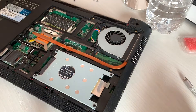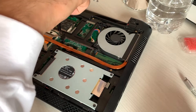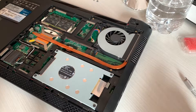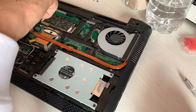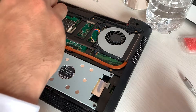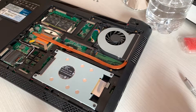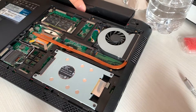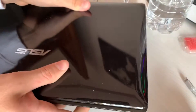The application is complete. Now I will just close it up, which is also a delicate part — but nothing to be worried about. Especially when dealing with direct die mounting, you have to be aware that mounting pressure is important. You want to go in an X pattern and be quite delicate. This is basically it — time to flip it over and see if it actually works.